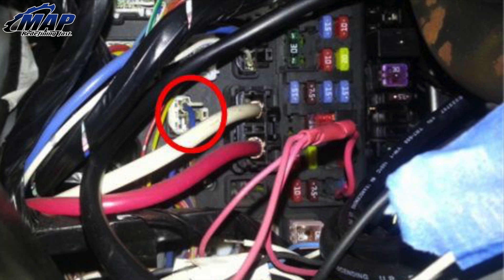The first step is to relieve fuel pressure from the system. Open the in-car fuse panel located above the hood's release lever, below the steering wheel. Locate the connector with a single blue wire and unplug the connector — the fuel pump is circled here in red. Start the car; it will stall out. Crank the car for a few seconds to be sure there is no pressure left in the fuel system.